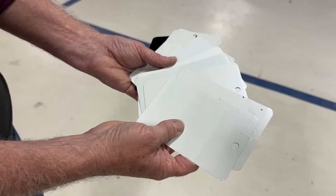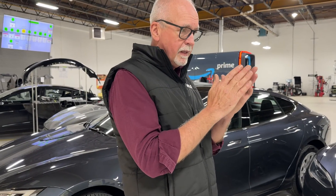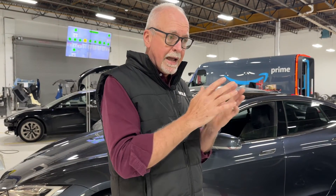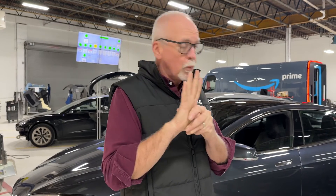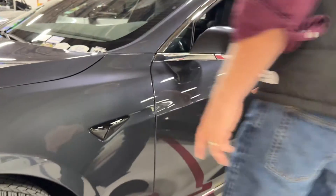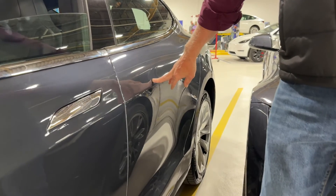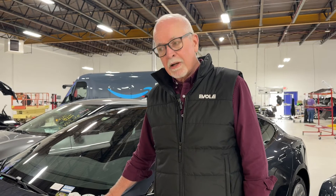So why is it important to know this? It's tricky these days to make sure your color matches after a repair. In many cases, each one of those color layers really has to be blended out — you need some room so the eye doesn't see the difference, because you're never going to get it exactly right. About 18 inches of blending distance is needed so the eye can't detect it. In a five-stage color, you have that four times — so we're talking several feet on a car potentially. If you had a repair on the front, you might have to go all the way back to the rear door to lose that color difference. This can be a challenge — not just to refinish, but to get paid by your insurance company for that work.